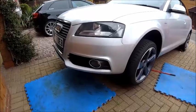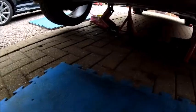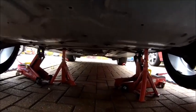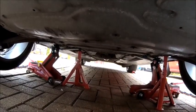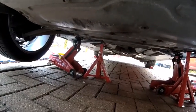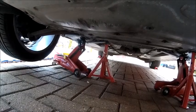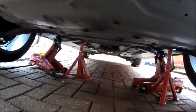The car's all jacked up and we've got the axle stands under. I got chastised in one of my videos for not putting those under properly. I don't let the jacks down on the jack stands — the jack stands are there as a backup. So if the trolley jacks fail and go down, it'll end up resting on those particular stands.